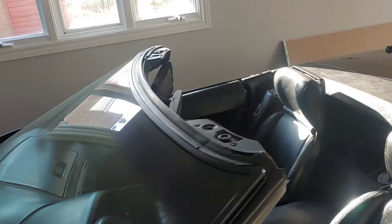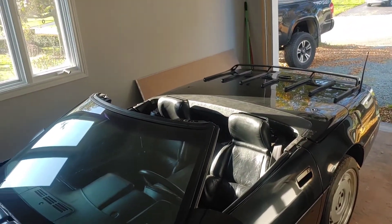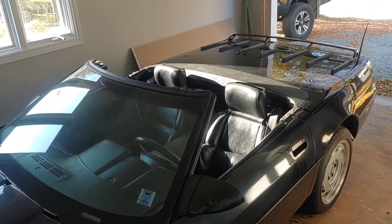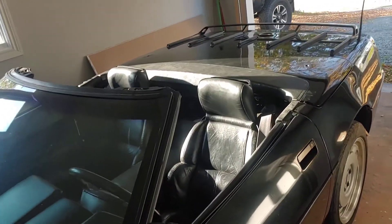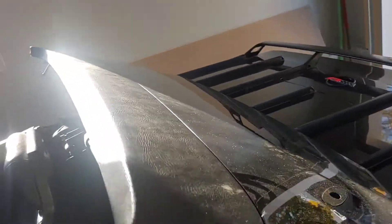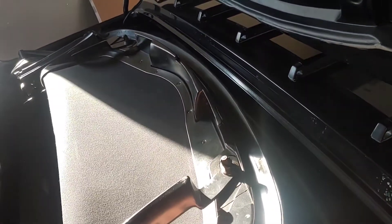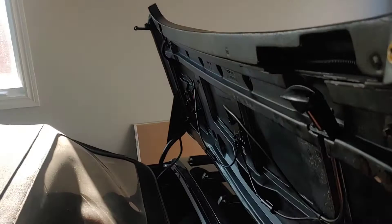And that is how you put down the top on a C4 Corvette. Now, to put the roof back up, exact same process, reverse order. Let's see if I can do this in one hand. Grab for my yellow button. Release the lid. Take my roof — bring it up. Line the pins with the holes. Just like that. Get this out of the way. Bring my lid down.